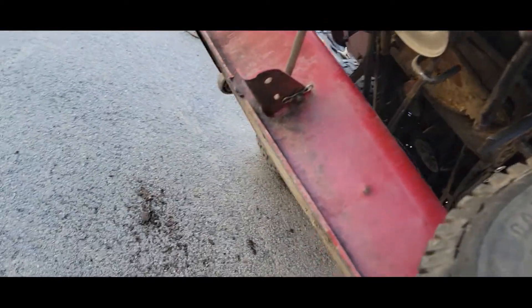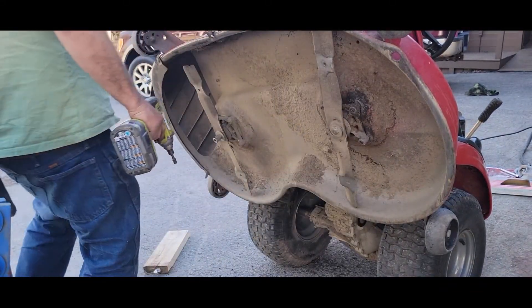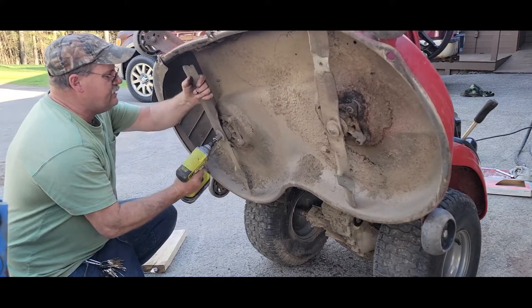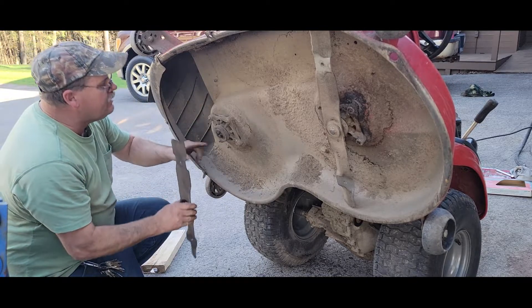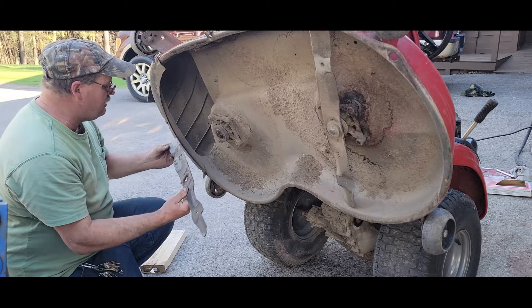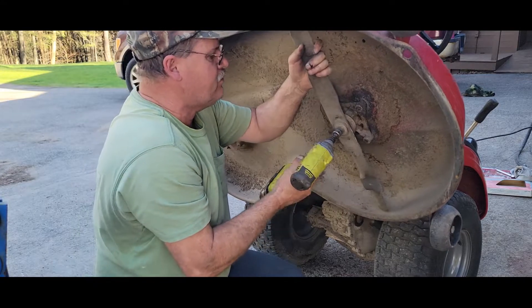That's it boys — let's see what we got under here now. We've got a guide and a guide on this one — goes around our idler, goes around another idler with guides, here's our guide. Now up front I don't think our belt would be falling off. Here's our guide on the opposite side — they match. Our belt can't fall off now. Actually the belt looks a little bit large for it — it's probably stretched.